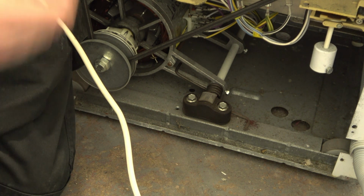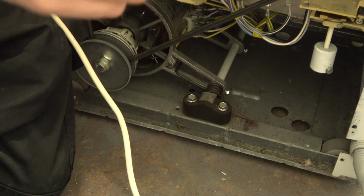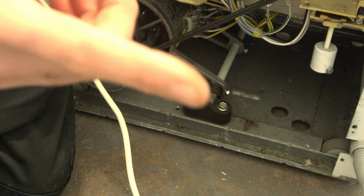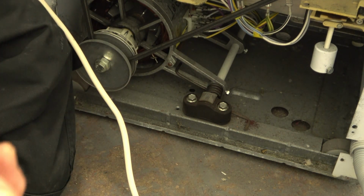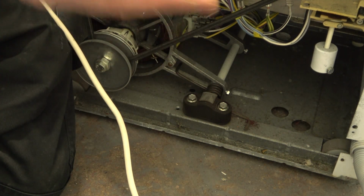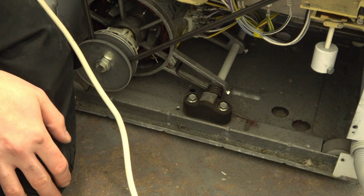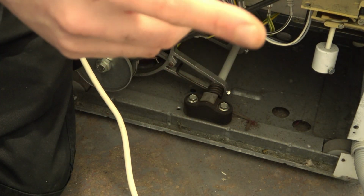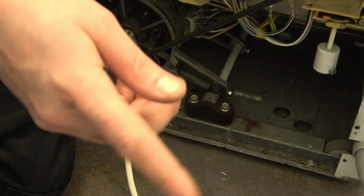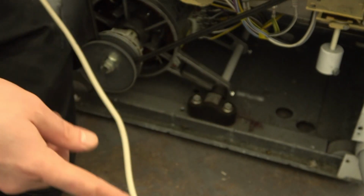Also, it tumbles the same way constantly throughout. So it has this tumble pattern, and even during the spin, when it starts to spin, part of the same tumble pattern is still running in the background. So when it stops mid-spin, because it's too unbalanced, you could be somewhere in that pattern. And that's why I often see it stop tumbling that way, come to a dead stop, go backwards, and then stop, and then immediately try and go into spin.